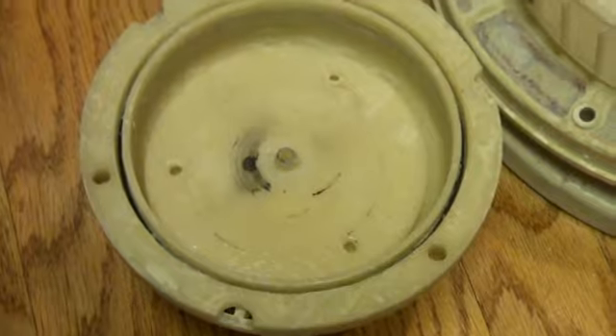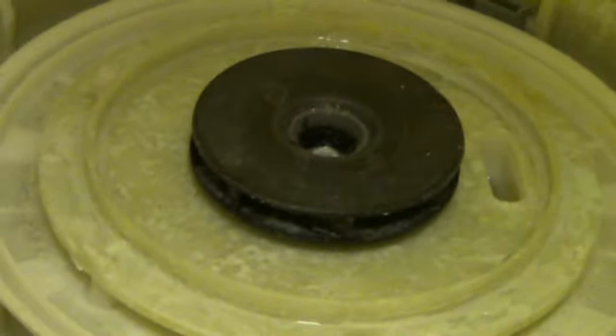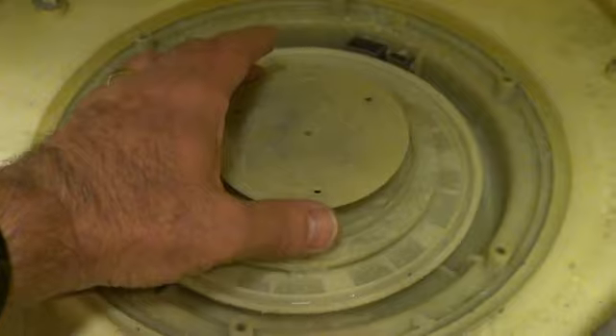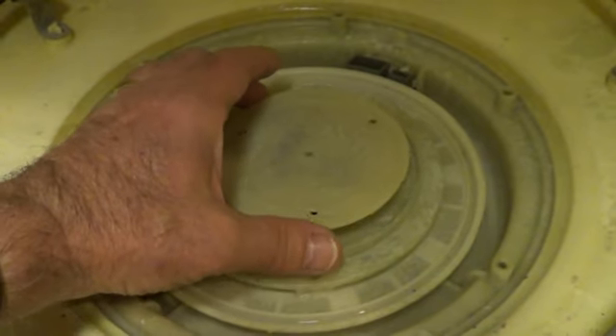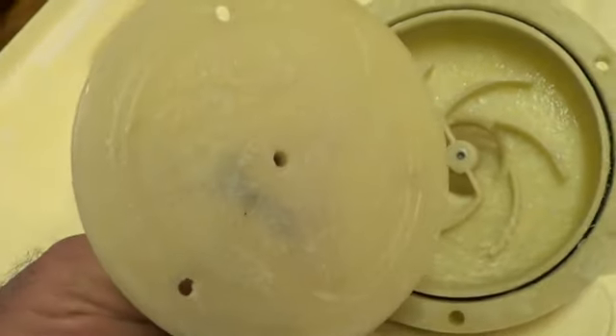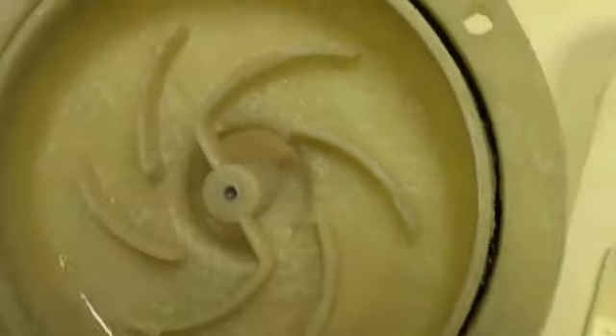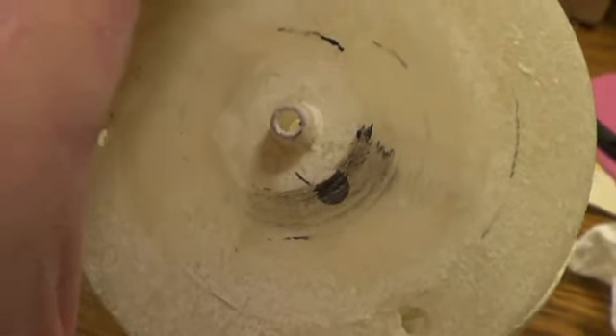With the broken cover removed, I'm going to go ahead and close the door. I think all that terrible noise we were hearing is basically this thing just laying on that impeller when it should be attached to the underside of that piece. You can see on the underside where that black impeller has been rubbing on this when it dropped down and broke loose from here.